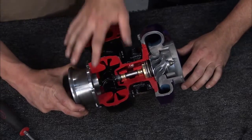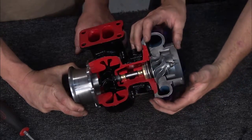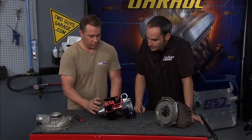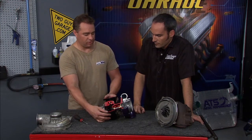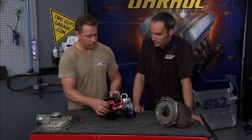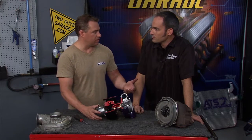So once this is set, your energy is correct. Now you can start pushing on the other side and compressing that air. When you design a turbo, you want to really start with the turbine section — make sure that turbine section is big enough to support the mass airflow of that motor. Once you get that determined, then you can hang a compressor wheel and a turbine wheel big enough so it doesn't get into that surge.